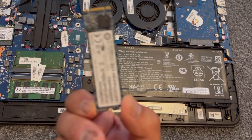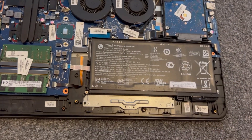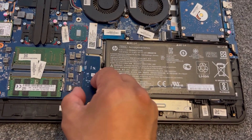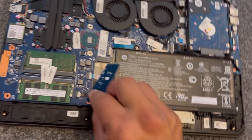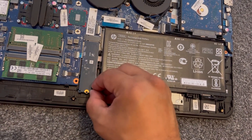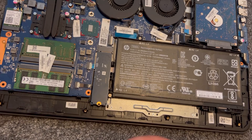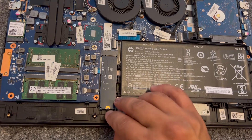This SSD only has 128GB — it's not much in today's technology. I'm going to upgrade it to a NVMe with 256GB. Just make sure you insert it this way. Sometimes it's very fiddly, but it's inserted now. Just double checking. Now put the screw back in and tighten it up.